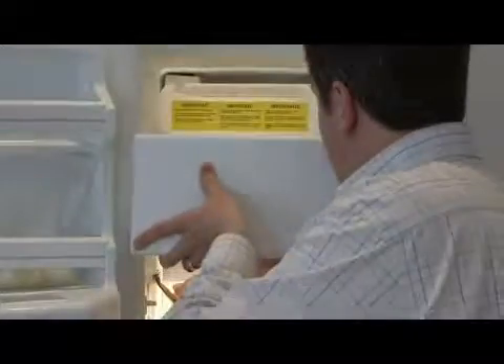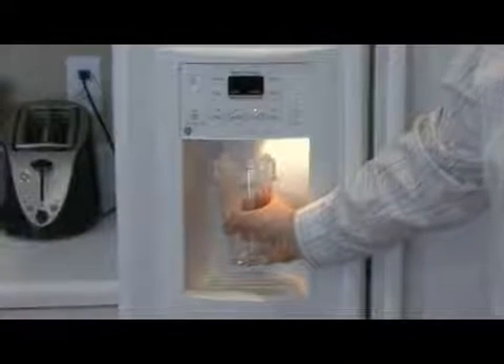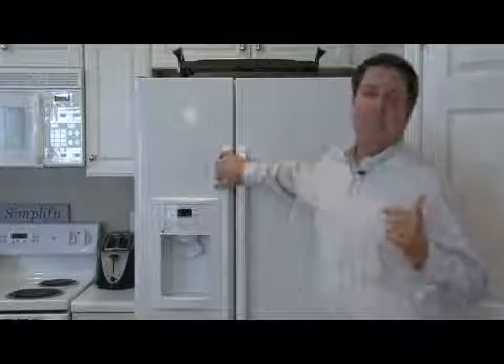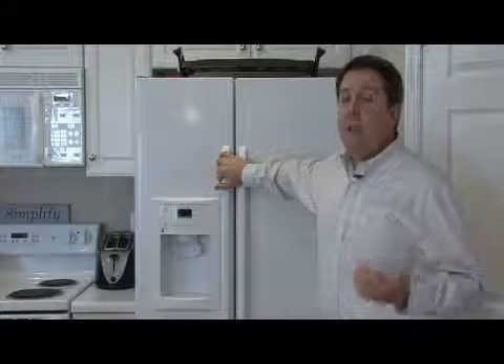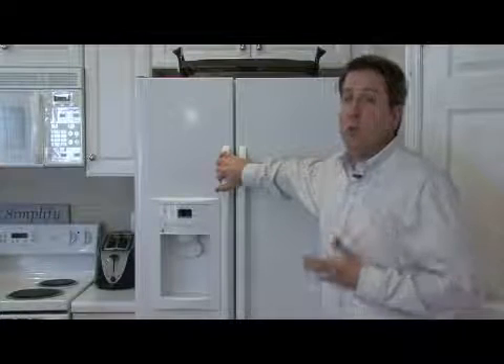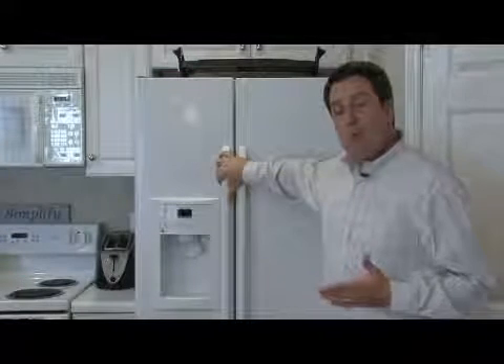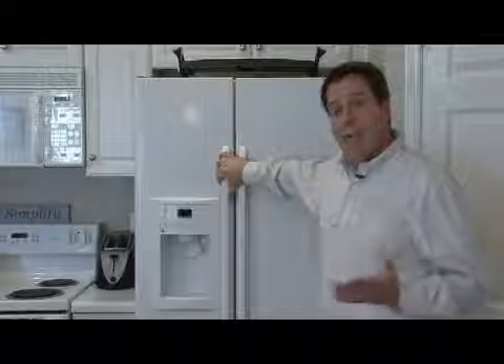Now the bin has an arm on it, and it knows when it's full because the ice raises up and presses against the bar and it shuts off. If you've got an icemaker and it runs out of ice, one of the first things to troubleshoot is whether that arm has been artificially held up — you just push it back down and the cycle starts again. Sometimes it can be held down artificially and it just keeps making ice, which means you open the door and get an avalanche of ice from the freezer. It's very easy to fix — you just look at where that arm is. If all things are working properly, you should have ice all day, all the time, whenever you need it.